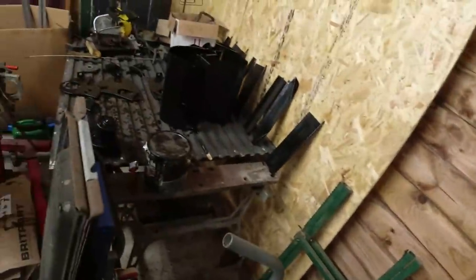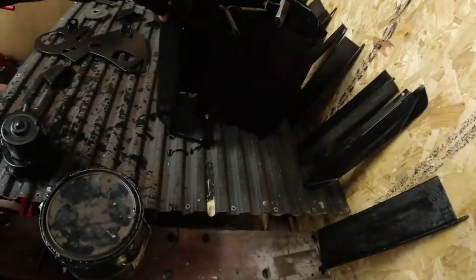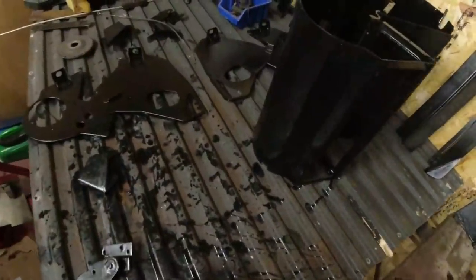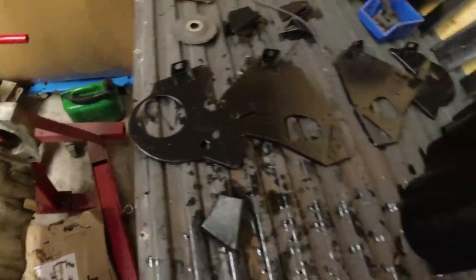Just check there's nothing over here. It's paint sticks today. I've had the heater going, so it's warmed up the workshop a little bit. Oh, yes. Good old flow. I don't know if this has gone completely off now. I might leave it another day, because it's an enamel paint. I use Rust-Oleum on this, just because it's tough and it goes on nicely. And when it's all settled out, you can't see many brush marks on it either. I'm quite pleased with the way it self-levels. That's all been brush applied. No messing around. Brush it on.